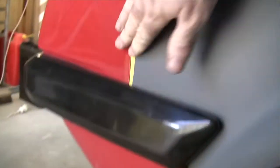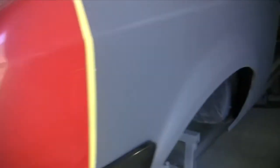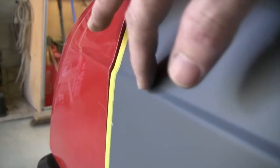A bit of plastic repair needs to be done in a few places. But it's there and it fits, and the lines pretty much match up. This guard hasn't been damaged - it's still original, there's no filler in that one. Whereas this one here has got a touch of filler in it. You can see a bright spot there, that line's not quite defined, but this is only an etch. It'll get the high build primer over the top of it, which will hopefully fix that.